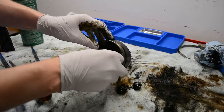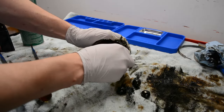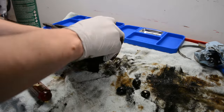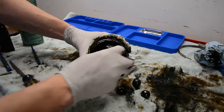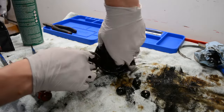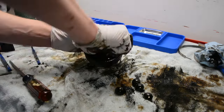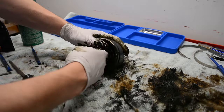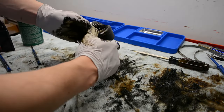With the assembly off the axle shaft, you can take it all apart to clean it and inspect it for damage. Before you do that, make sure you take a picture of how it looks — the cage and the race are directional on most CV axles, so you want to know how it was installed. The tripod bearings are non-serviceable, so if they are damaged, they'd have to be fully replaced. If anyone watching knows where to source internal parts like the tripod, ball bearings, or cage, please leave a comment or a link.